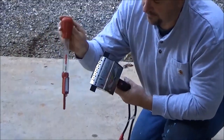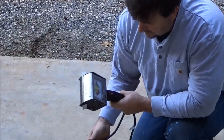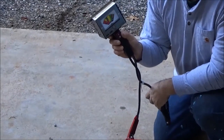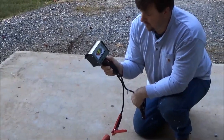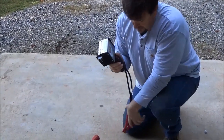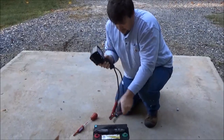I'll put a link to this — I think it's ten dollars — but you want to be able to check your lead acid batteries. The other tool is a basic load test. This is a standard 130-amp load tester where you push the button for 10 seconds and it will test 6-volt and 12-volt batteries. You don't test a battery bank — you need to test them individually. Hook up the negative first and the positive second.